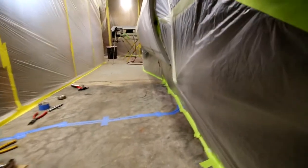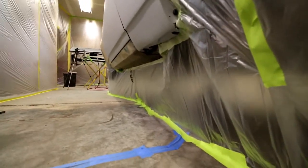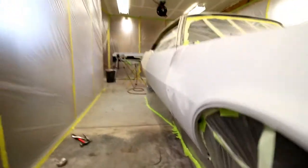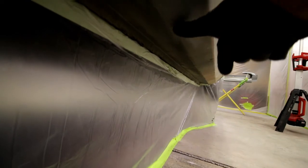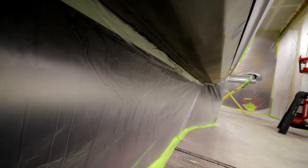So yeah, you can see the inside of the fender wells there, and all of that underneath on that rocker and everything gets cleaned up and painted. Like I said, I just want that all coated. It won't be undercoating in those spots. Some guys will run that transition, I think. I've seen it on other cars where they'll run the transition from the undercoating to painted surface, and they'll run that line here on the edge of the rocker. I wanted to run it on the body seam instead. So this will all actually be painted the same color as the car. This car isn't gonna be rotated on mirrors or anything. So as long as it's just nice and coated and sealed, I'm happy.